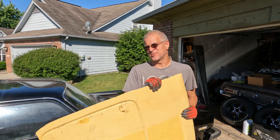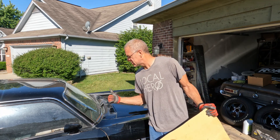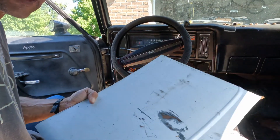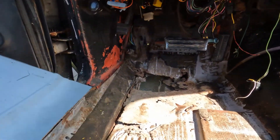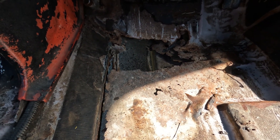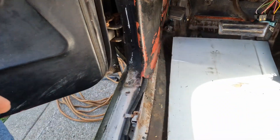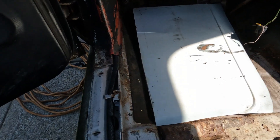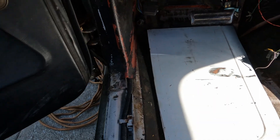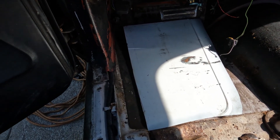This is going to be my new floor pan — this is what's left of my 2003 Chevy Express van that I pulled the 6.0 and the 4L80E out of for an LS swap. I managed to just cut up the rest of the van and save a few of these big pieces — you never know when you're going to need them for something just like this. So I cut a piece out of the van panel to fit right here into this nice gaping hole. The right thing would be to cut some of that rust out so you don't get moisture trapped between the panels and get even more rust. But we only have like 10 days left, so we're just going to take this dead blow and persuade the panel into formation, and maybe throw some sheet metal screws in there, and we're going to call that good for right now.